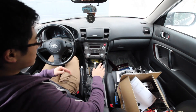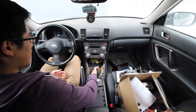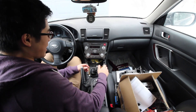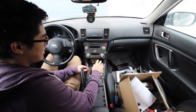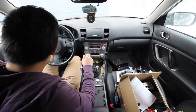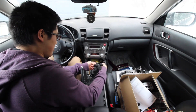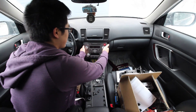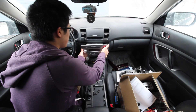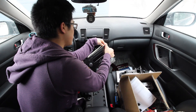With that all disconnected, the other thing I'll do is put the transmission into reverse just so we have enough clearance to slide everything out. Since this is threaded, it might not be a bad idea to wrap it in a microfiber towel just so it's protected — I'm just going to use an old glove so we prevent scratching anything. Now we can just wiggle this entire assembly out, and once we have it out far enough, we can start disconnecting everything.